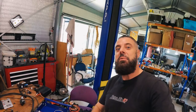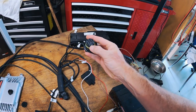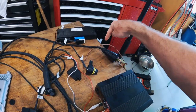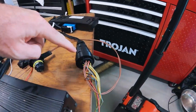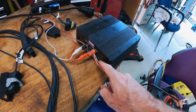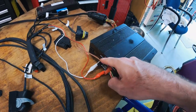Okay. Oh, well, we got there in the end. So it turns out the harness from my bench setup only uses one of the earth points on the standard 6HP connector, where the Lamik requires two earths. There are two earth wires. So I've just cut up an old 6AT connector. It's now plugged into the Lamik. So I've got the constant power, the 15 wake up, which is the normal BMW way of ignition on, so they're positive, and we've got the two grounds.